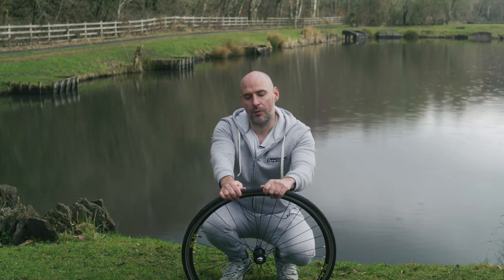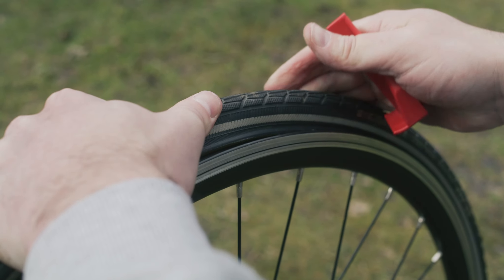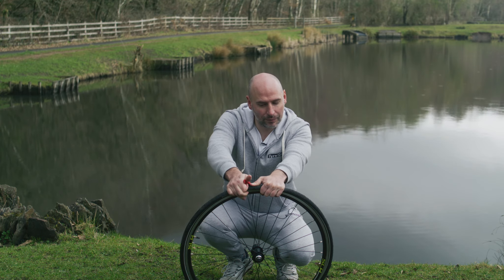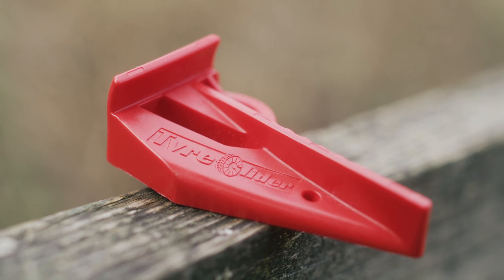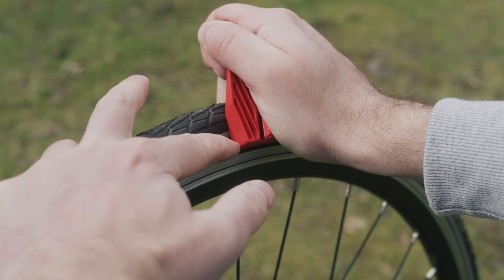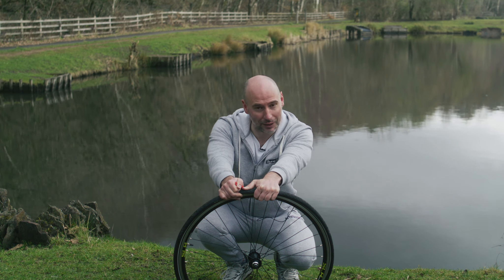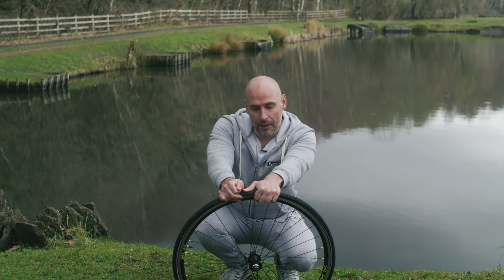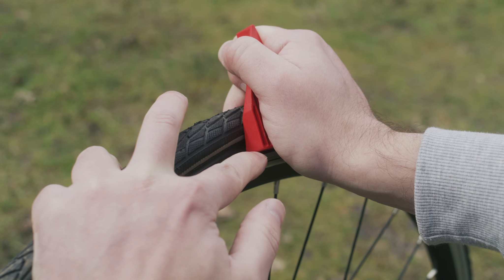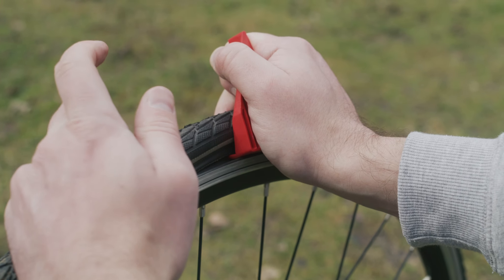Once it's in position, what I usually do is take my left thumb and place it in the middle, which then allows me to put the Tire Glider into place. So the moment I've got the Tire Glider positioned, all the force of that tyre is going through the thinnest part of the tool, which I do not want. So what I want to do is scoop it under to ensure that all of the scoop is under the tyre.